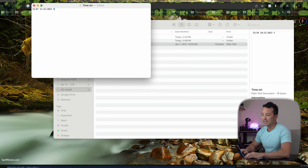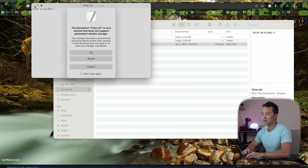Right here, this 'Y' — you have a yes or no option. If you leave it as yes, the time and date will be stamped into your videos. If you change that value to no — just an 'N' right there — it won't record anything on top of your video, so it's totally up to you. I'm going to keep it on yes for now. Then all you have to do is close that out, hit save, and you'll be good to go.